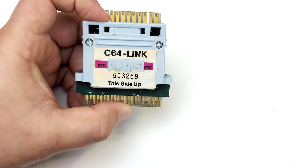I've actually thought of replicating these. I'm kind of fixed on one day rebuilding a Commodore network from two or three machines. I recently passed on a couple of Commodore 64 lock cases identical to the ones in our school computer lab — I would have loved to put a couple of my breadbin 64s in them and set them up with these C64 Link 2 cartridges. If I can figure out the wiring of the VL1 or VL3 cable for this edge connector, I should hopefully be able to build a mini Commodore 64 network, and if I do I'll definitely make a video of it.